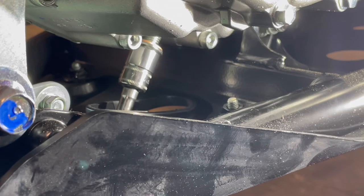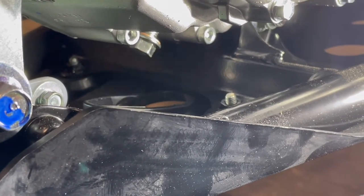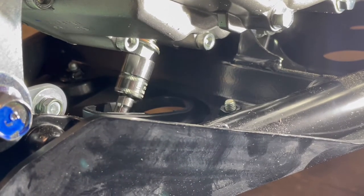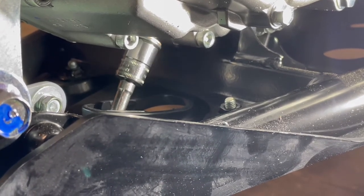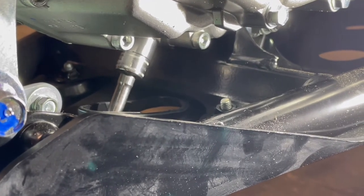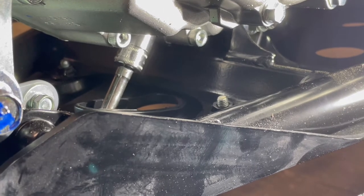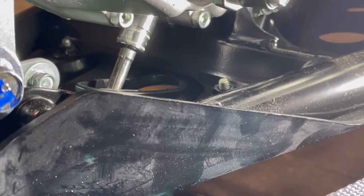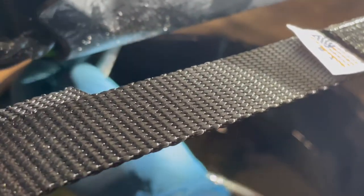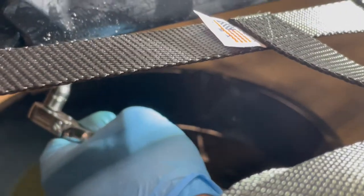And start nice and gentle by hand, right? And if you're afraid of using the ratchet, don't be afraid to take it off and just do it with the extension. That way you have a better feel. You're not starting crooked. That's the worst thing to do, start crooked, and you mess that thing up. And believe me, engine cases, they're not the most expensive, but they're about $550. And that does get expensive.